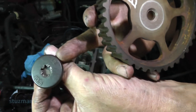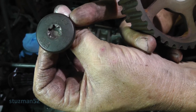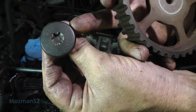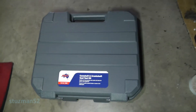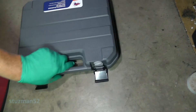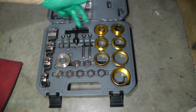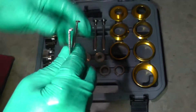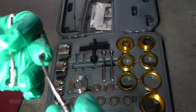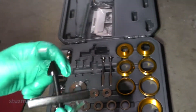If you've already had your timing belt changed, you might want to inspect right in here — I was worried this was going to strip out even more, and then I would have really had a problem. Take note of that before you break it. Alright, we're going to be replacing the camshaft seals along with the crank seal. This is the tool kit I'm going to use. For the camshaft seals we'll use these two short pullers, and for the crankshaft seal we'll use the long ones. These little picks go in on the side of the seal — push in, then turn up. Do that on both sides, then use the puller to pull the seal out.